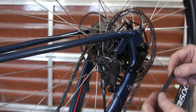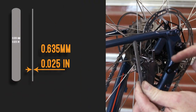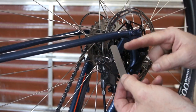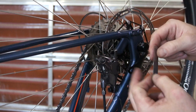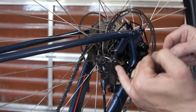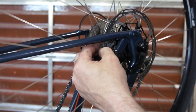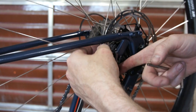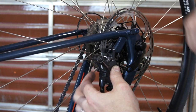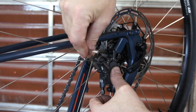To adjust this caliper, I'll take the bolts loose and I've got a 0.635 millimeter or 0.025 inch feeler gauge. I will insert this between the caliper body and the rotor — this is the exact distance to make up half that width. If I tighten this caliper body down with this in place, it will center the rotor in that body. I'm going to push the body in, tighten down these bolts, and now I know the body is evenly spaced between the rotor and the caliper.